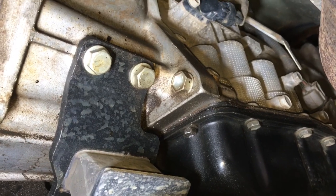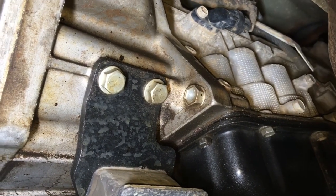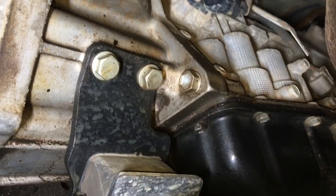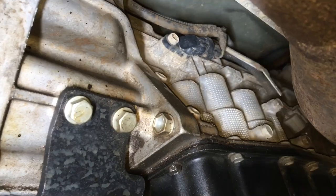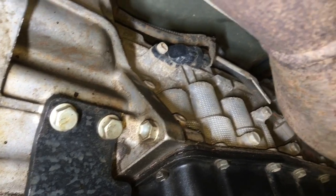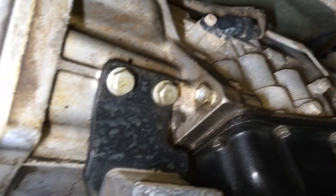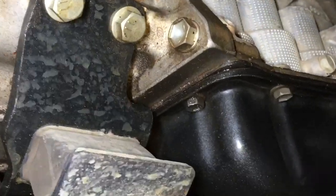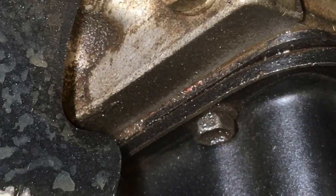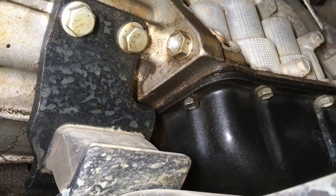There's a bit more of that red evidence at this side of the pan. If it was clean and dry as per Toyota's recommendation with the torque spec of 4.5 Nm, it would be factory clean - but they obviously haven't done that. We might put a tool on them and just give the bolts a bit of a nip and see if that stops it. That red stuff isn't Toyota, and Toyotas don't have pans that leak like that anyway.